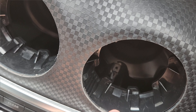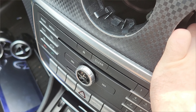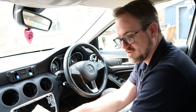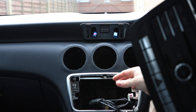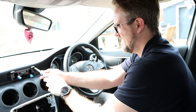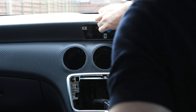To remove the radio, what we're going to do is put our finger in here and you can see that there's a bit of a catch — that plastic catch here. So if we push that down, you'll see that the radio pops out, and that is how we are now going to remove this radio. I'm just going to detach all the wires from it. But don't forget, this will be going back in — we just needed to remove it to gain access to the connectors behind it. Next, we're going to pull this off and just remove these three screws.